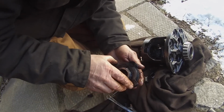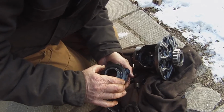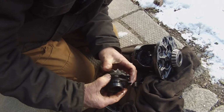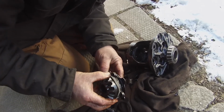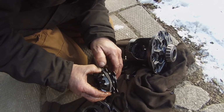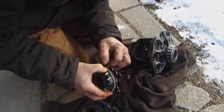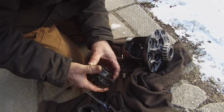Let's take that snap ring off. I bet the splines might be stripped. Yeah, that one's okay. These slip, the inner ones don't. But obviously that's broken, I think. Really not. Yeah, see, it's not supposed to be split. That's what's the matter. And it spins, it shouldn't spin. Do I have a snap ring plier we can get that off?